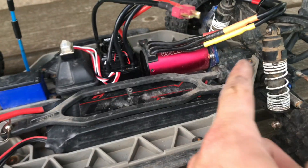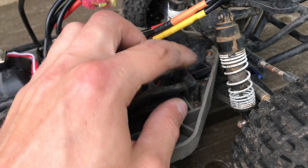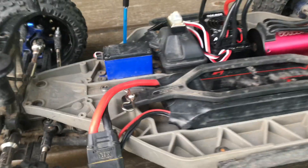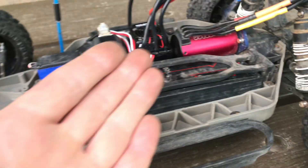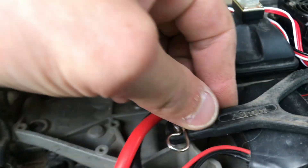What I did was I ordered a new higher battery strap down from Traxxas — it's a Traxxas upgrade part — so you can put a taller battery in. I'm waiting on that to come in, but once it does, we're going to be able to fit a 4S pack. This pack right here barely fits under it, probably because I have it on 23mm. I need to flip this over, but this one still barely fits underneath.